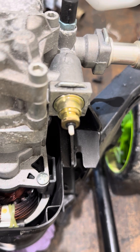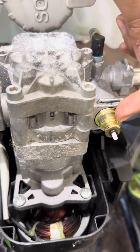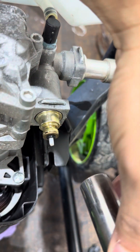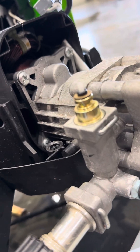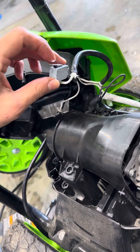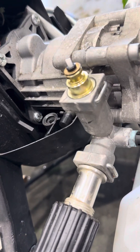I'm assuming it's not extending properly. I will then have to replace this, which is super easy — literally just pull this thing up, pull that out, and it's likely just a quick slide-in replacement. I did have to slide a socket over it to get enough force to overpower the spring and push it down. If it's working properly it does go up and makes contact with that switch. So my issue is inside of there.